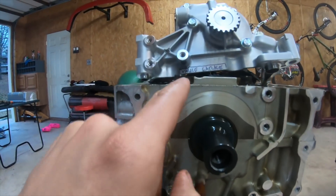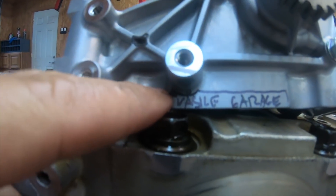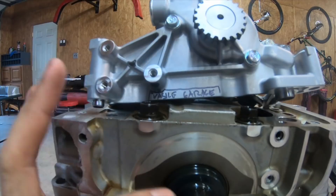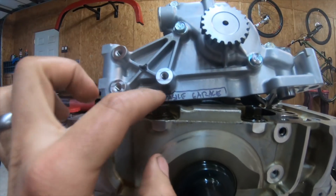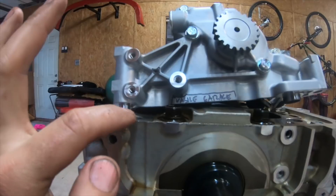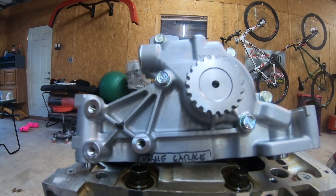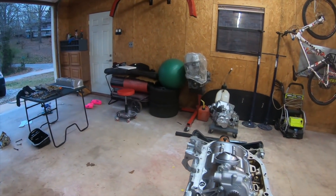With a little better lighting - we have this obstacle right here in the way and we have to cut right there. Don't go too crazy because you need to bolt that little tensioner for the chain that goes around the crank. Don't go too high up to the crank - pretty much go straight up, over, and right there. Make sure you tape all the ports so you don't get any shavings inside. Take your time with it and we're gonna shave it. I'm probably just gonna use a grinder wheel to grind from here to here, cut it straight across.